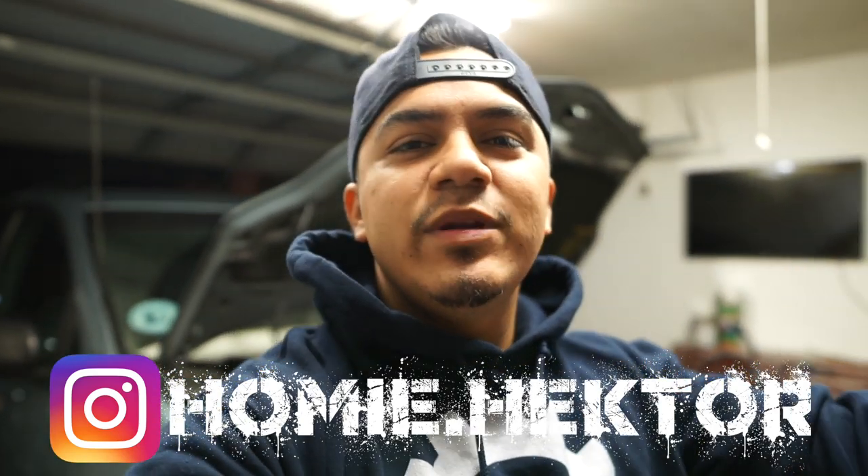What is up you guys, welcome back to the channel. Today I'm at home — I got this 2006 Toyota Sienna behind me. A customer brought it in because the truck is overheating. I've already diagnosed it, so we're just gonna run through the job: changing out the thermostat and doing spark plugs on this van. We've got to remove the wiper cowl so we can move the intake and access the back three spark plugs. It's a pretty labor-intensive job — spark plugs call for about 3.5 hours, the thermostat about 1.5, so all in all it's gonna be good money. I'm gonna bring you guys along to show you how to do the thermostat and the spark plugs, then we're gonna bleed the system, test drive it, make sure everything's good, and ship the van on its way.